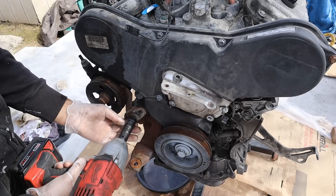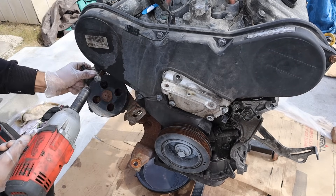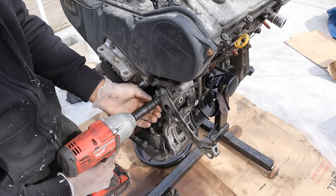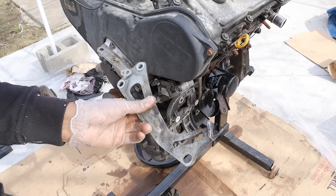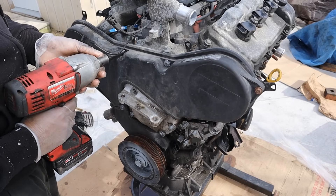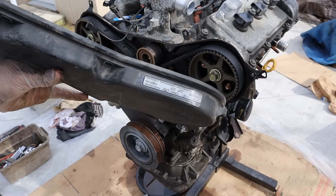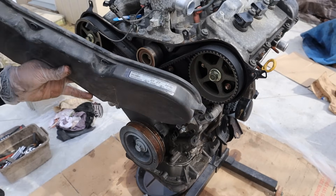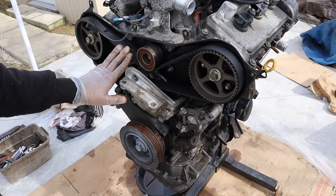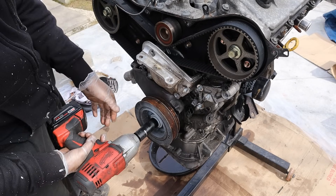Starting the teardown at the front of the engine by removing the power steering pump, the side engine mount bracket, the alternator bracket, and the AC compressor bracket. Next, removing the 10mm bolts holding the timing cover on. There's actually nothing wrong with this engine — it came from a dealer-maintained car with 170,000 miles when it crashed, the timing belt was changed at 160,000 and is fairly fresh, and the oil that came out was really clean. Now let's see if we can get this crank bolt off — these are notorious for being tight on Toyotas.